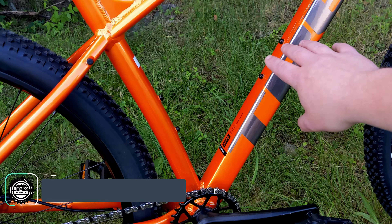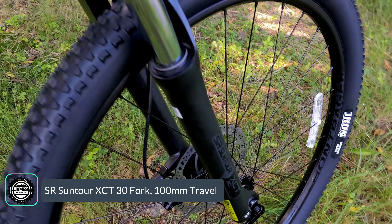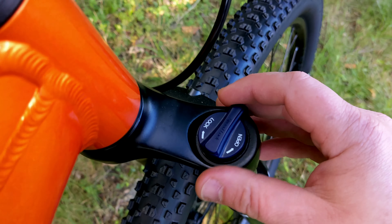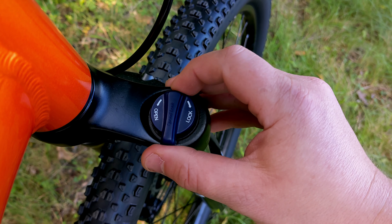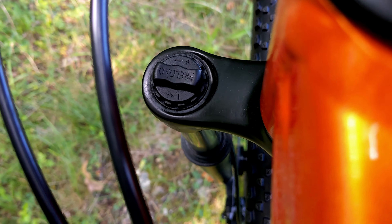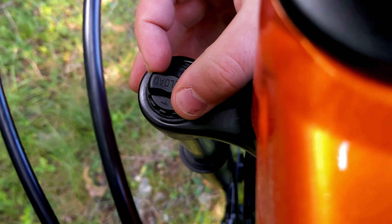Along with that Alpha Silver aluminum frame, there's a 100-millimeter fork — 100mm on sizes small and larger, and 80 millimeters on the extra small. This is the Suntour XCT30, using a 30-millimeter stanchion on chrome-plated stanchions. You have an adjustable damper to lock it out or open it up, and on the other side of the fork there's an adjustable preload. In my experience this doesn't do too much to adjust the suspension, but it is nice to have that feature.